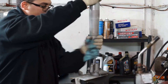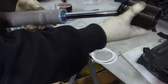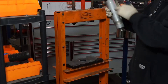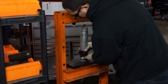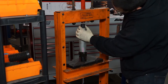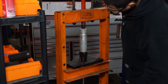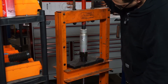After the sticker is removed, clean off any excess WD-40 or dirt on the strut tube. Now that the strut is bare, slide the Pro-S sleeve over the strut and make sure to align the sway bar tab with the mark you had made earlier. With the help of a press, insert the new spring seat with the shock tube facing upside down. To prevent damage to the bottom of the strut, use a socket or a spacer to cover the nut on the bottom of the shock. After aligning the shock, make sure to add some WD-40 as the lubricant will help slide the sleeve right on. After a few pumps on the press, you should know when the sleeve is seated due to the force returning to the press arm.